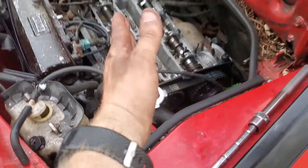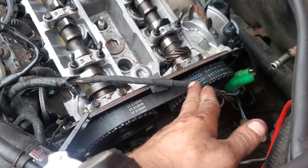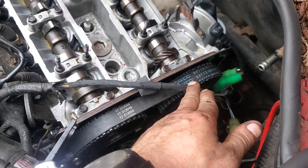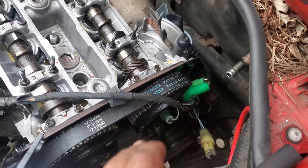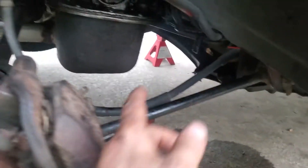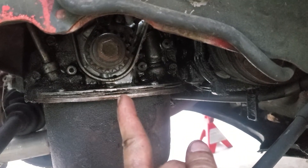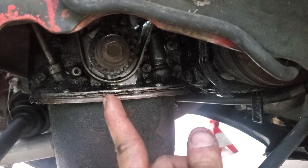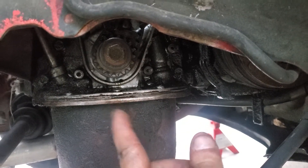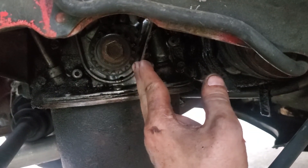Have the tensioner all the way loosened. And then when it's up here, tighten this side just a little bit so that it lines up the cams, or lines up the dot with the mark. Then go down here, get your ratchet, and retard the crank sprocket just a little bit. Then hook the belt on it and advance it slowly so it puts tension on this side of the belt.